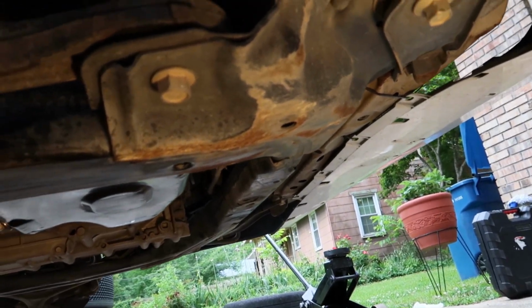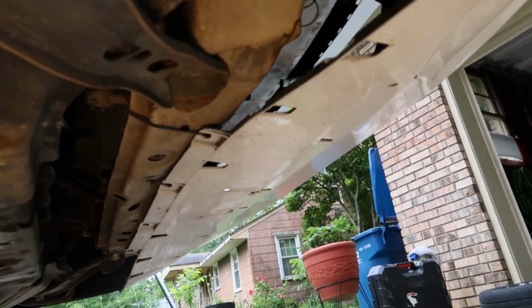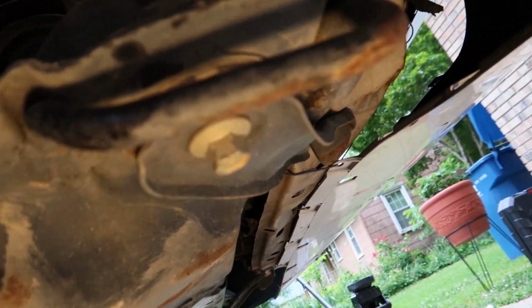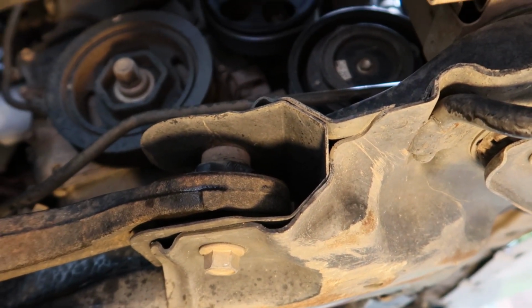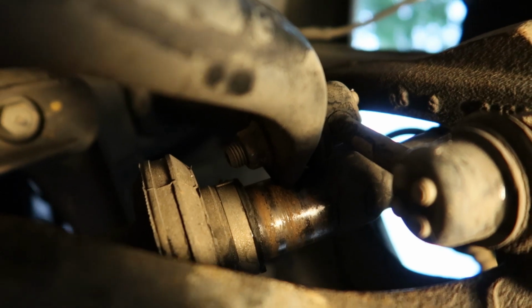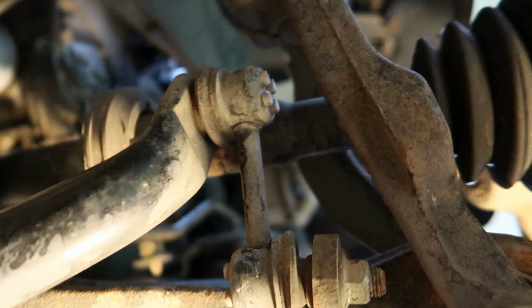So just a quick assessment of the front of the frame. It looks good. It's scraped up there, but not damaged too badly. Now where the radiator meets the little subframe up front, that's bent up, and you can see they zip tied the actual front of the bumper to that because they can no longer attach it with those push pins. But not a problem. The radiator's not leaking. It's still working correctly. So we're more focused on getting this damaged upper and lower control arm fixed at this point. And we're gonna look a little bit closer at this sway bar and end link now.